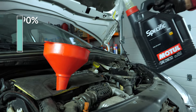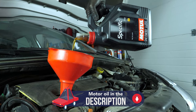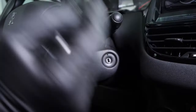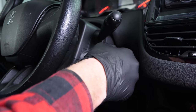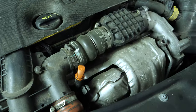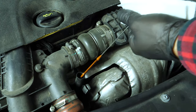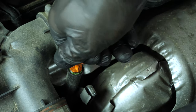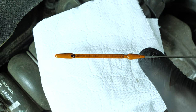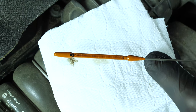Begin by putting in 90% of the suggested amount — this will leave you a large enough margin to adjust the oil level appropriately. You can find the exact amount of oil suggested for your car in the description of the tutorial. Close the oil fill plug, start the engine, and let the car run for 30 seconds to fill the oil filter. Remove the oil gauge and wipe it down. Plunge it back into its sheath, remove it again and check the oil level. The optimal level is near the maximum, but be careful never to go over it. Based on the level indicated on the gauge, adjust to obtain the optimum amount.